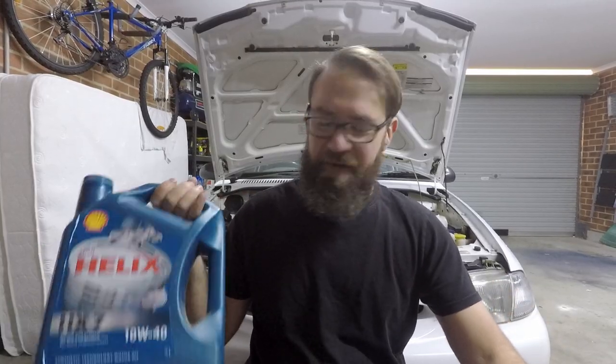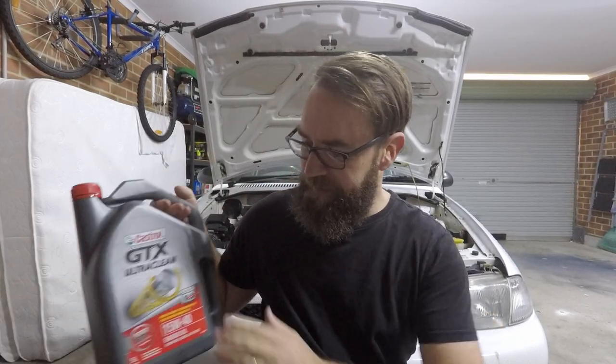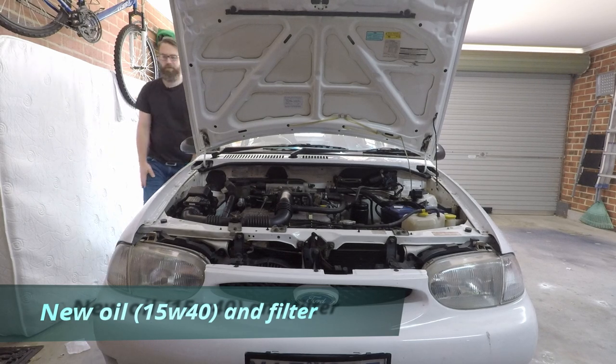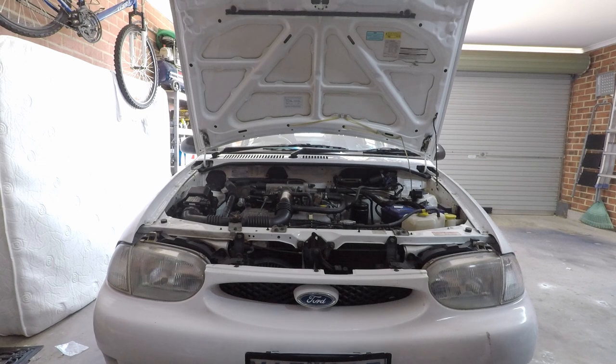You could really hear that 10W-40 flowing around the engine. It did originally have 15W-40, so that's what I'm going to add for the next 1,200 kilometers for a decent comparison between the original oil and the current one. We'll have another look in 1,200 kilometers and see what the engine looks like — if it's still running at all. I'll put this new oil in, let it cool completely, warm it up to operating temperature, and have another listen to see if it sounds any different.